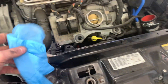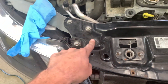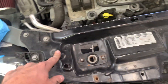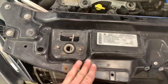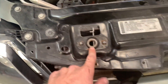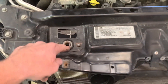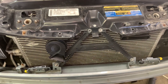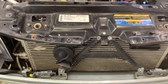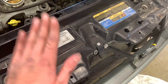If you'd like to make this job easier on yourself and you don't need to put this back on, you can remove it. What you'll have to do is first remove a bunch of bolts — they hold things like your headlight — and then these all mount this cross-member subframe down to the actual car. You also need to remove your wire rack, which helps lock in your hood, and you'll have to remove this as well. Now the manufacturer puts a little safety rivet on so they can tell at the dealership whether you've messed with it, so you might have to break that if you intend to remove your radiator.